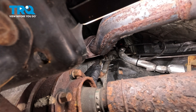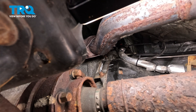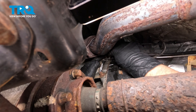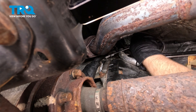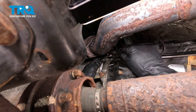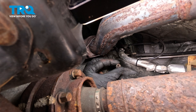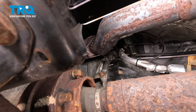In this area we're going to have to dislodge this bracket. You'll find that you have a 10 millimeter headed mounting bolt, and then up above it we have a 10 millimeter headed mounting nut. The nut is attached to a stud which is attached to that engine housing. Let's start with the upper mounting nut — this is the hardest to gain access to, but it's not that hard to reach up there. I'm going to be using a ratchet wrench. A quick inspection of the mounting hardware — replace as necessary. This looks fine, we'll set it aside.